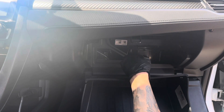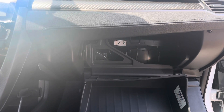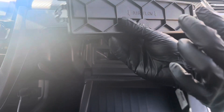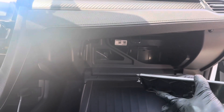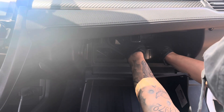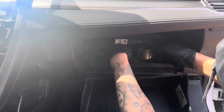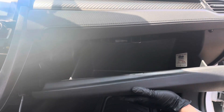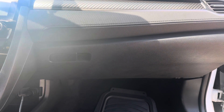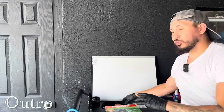And that's it. From here, just put the clip back on — remember, orientation facing downwards. Snap it back into place, just push in, and all you have to do is lift this right up. Easy. And that's it — cabin air filter is changed! Hopefully you guys found this helpful — it was quick and easy.